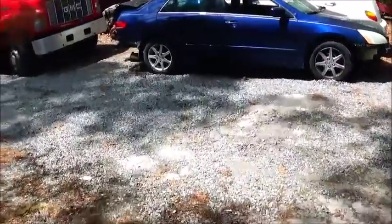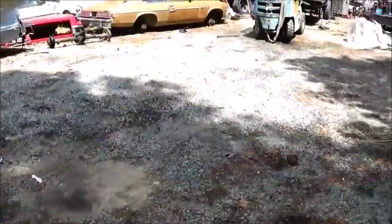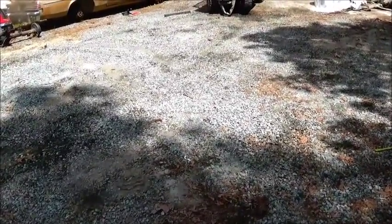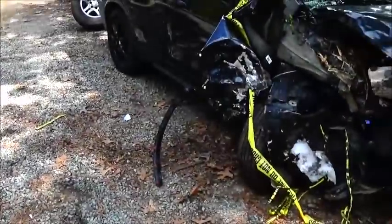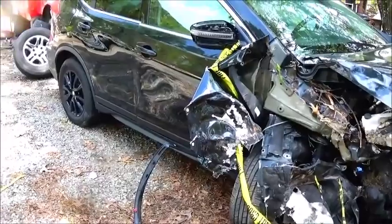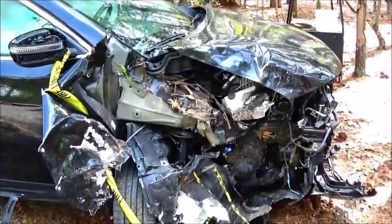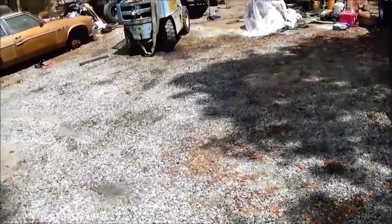We worked on the International rollback yesterday too. I had to put a pressure relief valve in — got it fixed. I thought maybe the governor was bad, but it turned out to be the pressure relief valve, so that was a good thing. Got it taken care of, and I was glad to get my white truck done.